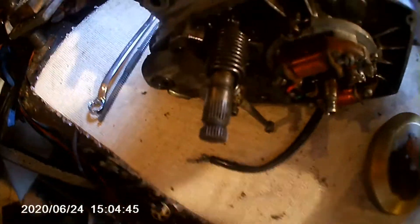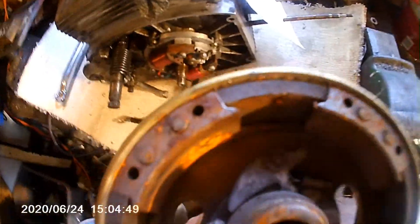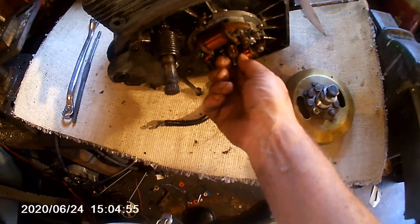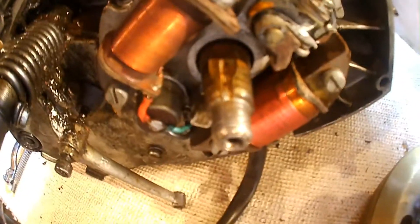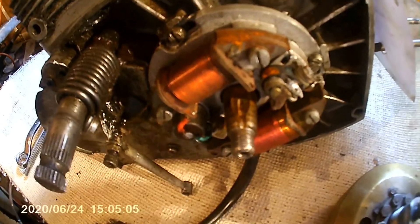The keyway is still in there. There's a strange marking - like a piece taken out - haven't seen anything like that before. But anyway, it's off and it was tight. There's a little bit of rust but it's just these taper fits - that's a fantastic bit of engineering. They seem to be the longer they're on there, the more difficult they are to get off. If you try and get that off any other way, you have to damage the magnets, because when you bash at it you destroy the magnetism. And then you've got the coils at the back end.